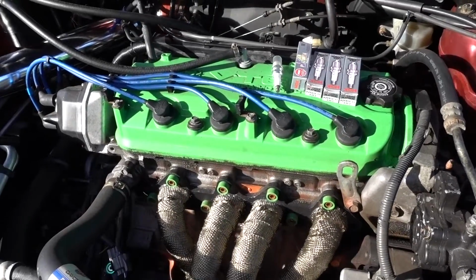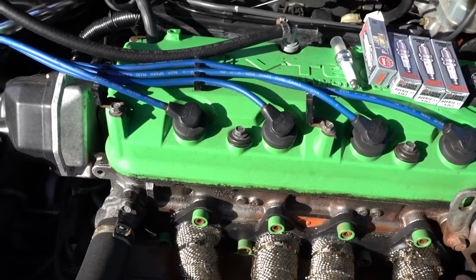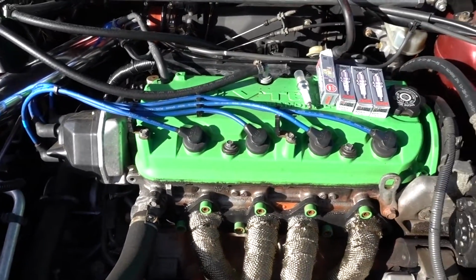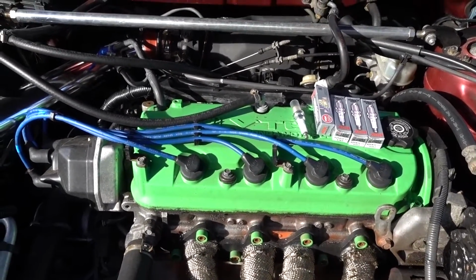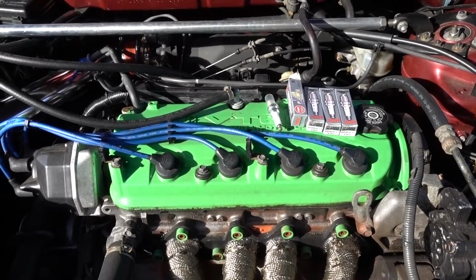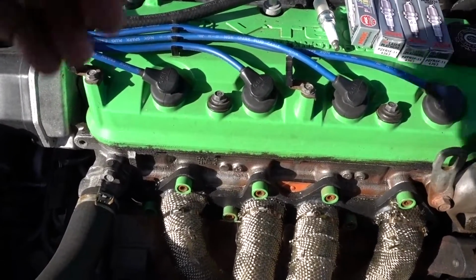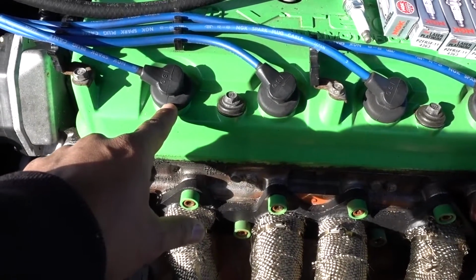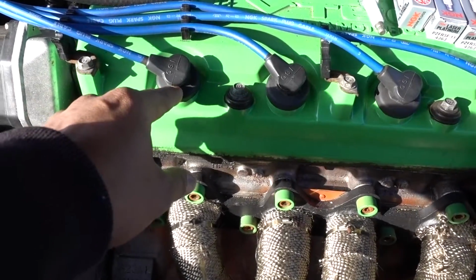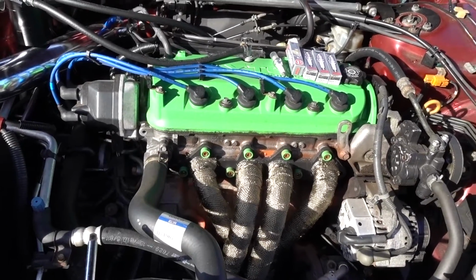It took me like 30 minutes just to go in there and try to get that rubber that was inside the spark plug tube. Why? Because I put the spark plug, I removed the socket, and those four tubes were full of oil. So I told the owner about it, and that day I replaced the spark plugs, and the week after, I replaced the valve cover gasket and the little grommets inside. When you have an oil leak from the gasket, all the oil from the motor always goes inside the spark plug tubes. So that was the problem that it had. They were full of oil.